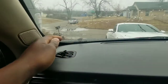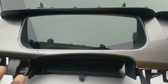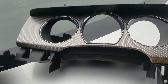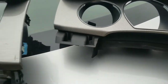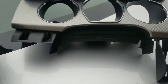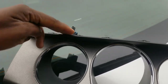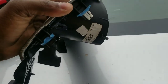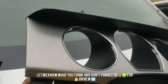I'll do a little diversion here to show you exactly what I meant. This is the type of look that you have on 2013 and up, and this is the look on 2010 to 2012. This one was an SHO, that's why you have the little carbon-looking texture thing going on there, and this was an interceptor. When you're using your prying tool to get it out, you have two tabs here that are sticking pretty tight. You have two more on the side, one here and one there, and two more on this side — a total of six.